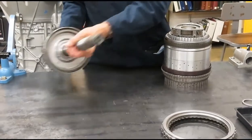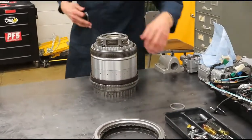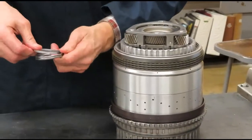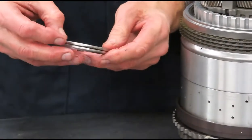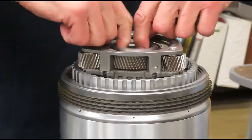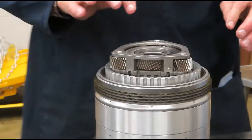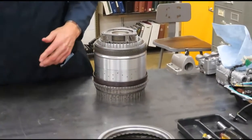And this is planet number three. The rest of the bearing just fell out, and this little thickness washer sits in that pocket. This thickness washer — I think it sits with the washer up. There's a little teeny inside area of this bearing that sits in this little pocket nicely. I'll keep that over here by that input shaft.